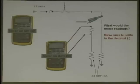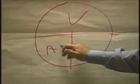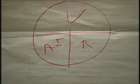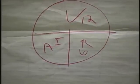2 amps. Okay. Right. If you're looking at Ohm's law, what's on top here? V. What's over here? A. A or I, guys. Right? So we'll put I, and here's resistance. So, in this case, when you know you've got 12 volts, and let's say we had 6 ohms of resistance, how many amps? 2 amps.